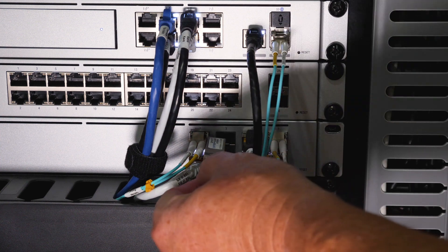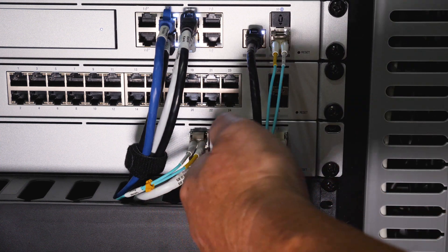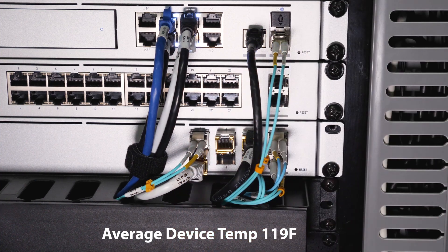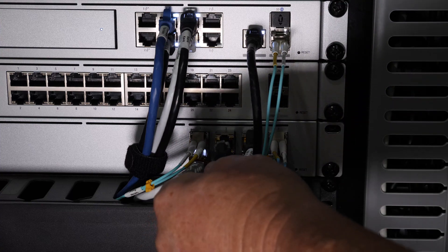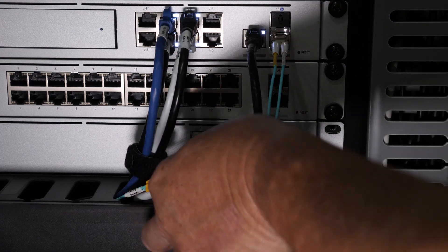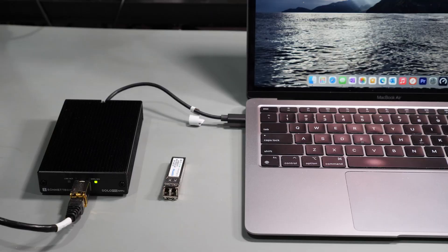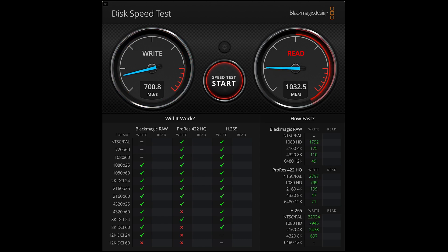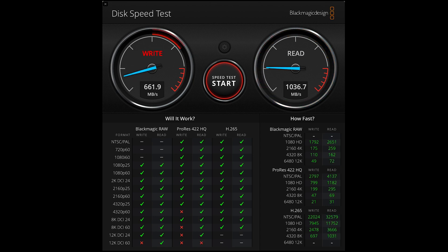Let's take a quick look at how RJ45 transceivers work and take some temperature measurements. The installation is pretty straightforward — all you have to do is insert the copper transceiver into the SFP Plus port and attach your RJ45 cable to it. I used a matching copper transceiver on my 10 gigabit Thunderbolt laptop adapter for quick testing of communication and performance. The performance is currently limited to my network's write speed, but it is very solid and matches what I'm getting on my PCIe card in my desktop.